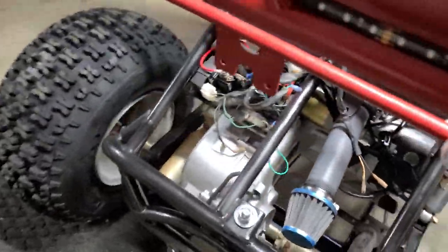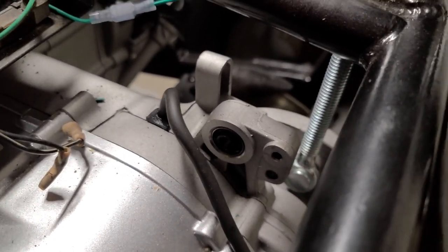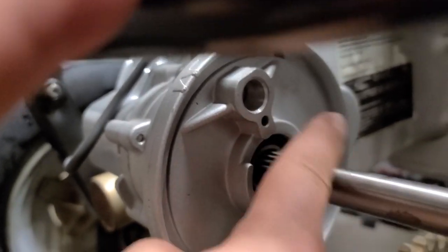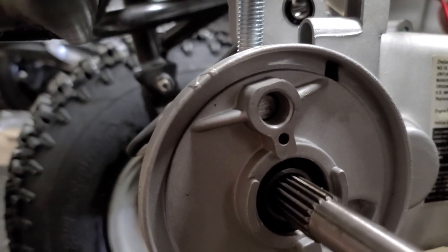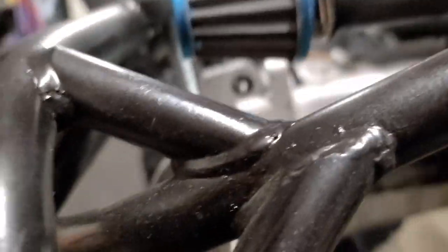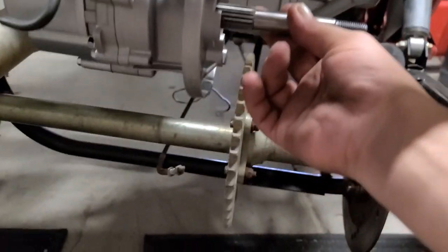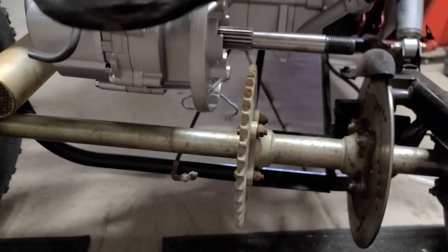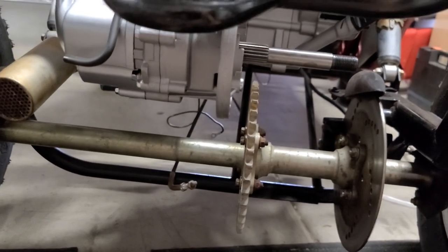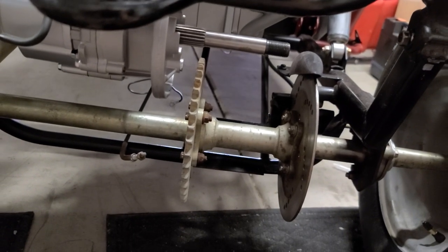I did get my rear mount done. This is actually from a fence piece — it has a little L-shape on the end of it. It was a little long so I had to cut it and got it to slide in right inside there. It does an L, comes down, but it has adjustment — you can see the threads all the way down so I can adjust it up or down depending on the chain tension I need. That thing ain't going nowhere. It barely moves and I don't even have it tight yet — just finger tight on top. I have my reverse box coming in that will hopefully slide right on, pop the chain in, and I've got the chain link, so we're good there. We're making all kinds of progress.